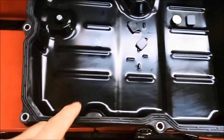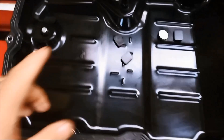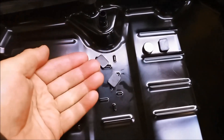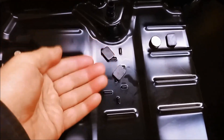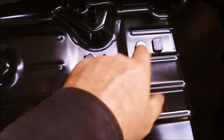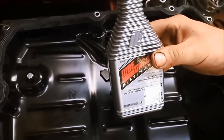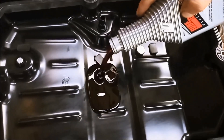The pan's nice and clean. We've replaced the rubber seal or the gasket. We like to put these magnets up on those little ridges just to try and get more surface area of the magnet working top and bottom to track any fine metal. We're going to add a neodymium magnet. And because he does a bit of towing, we're going to add a Lubegard Platinum to it.